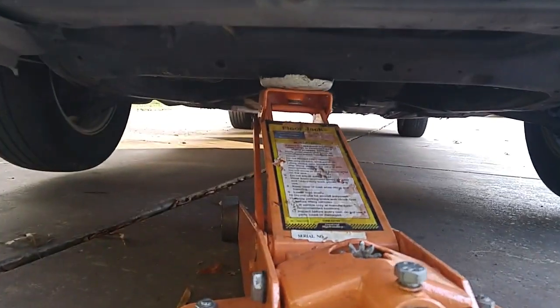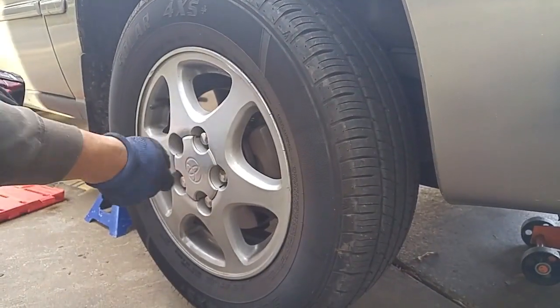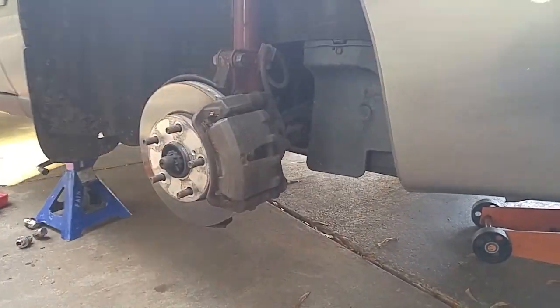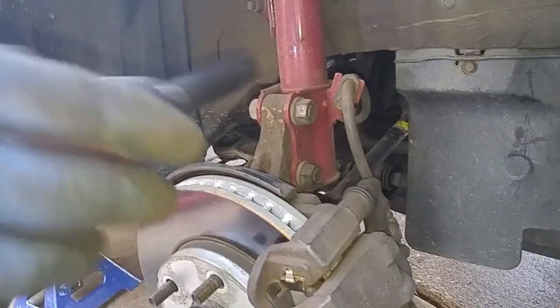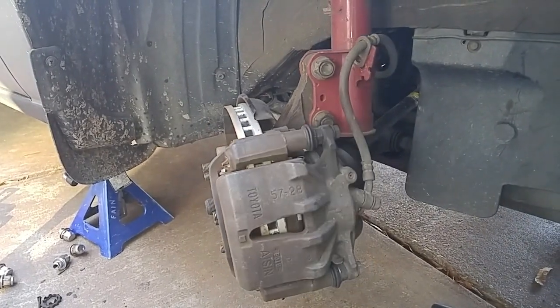If you watch one of my other front wheel drive hub and bearing replacement videos, I use the high torque impact gun to torque out the old bearing from the steering knuckle. High torque twisting pressure from the impact gun applies force on the adapter against the bearing in the steering knuckle. I found another way to apply pressure without any twisting force.